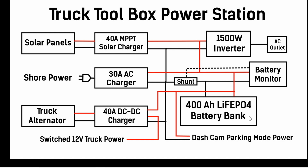That solar charger charges the 400 amp-hour battery bank - there are a couple of 200 amp-hour Ampere Time batteries, the self-heating variety. That's the main power center. I also have a way to charge via shore power - a 30-amp AC charger I reviewed a couple months back. I also have a 40-amp DC-to-DC charger, a Renogy I've used for a few years. I'm currently testing an SRNE DC-to-DC charger in the RV, so the Renogy became spare and I've wired it in so I can use the truck alternator to charge at 40 amps.